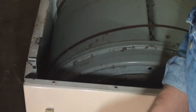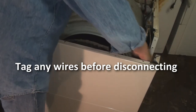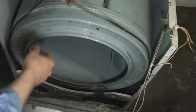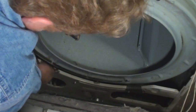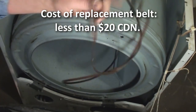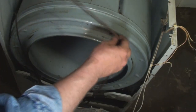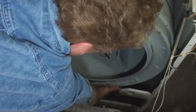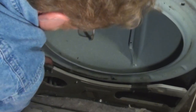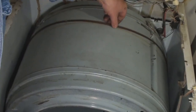You can see it's just ready to come off all by itself. Now with those two screws out you're ready to pull the front end forward. You can disconnect these wires if you want to. We've got the belt here — whether you're fishing it off or fishing it on, you just have to get around that little roller there, and a little roller on this side, and out it comes. I'll put it right back on again because there's nothing wrong with this one, and this unit is going to the recycling centre right after filming. So I'm just going to lay it on top, reach underneath, and pass it past that roller on each side, and work it towards the back. You can see a stripe where it used to run, so that's where I want it to run.